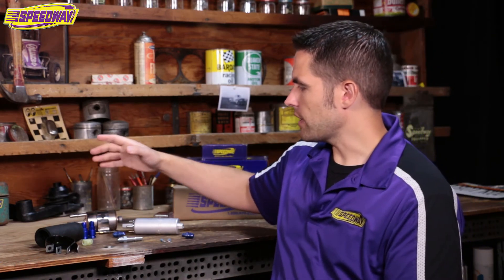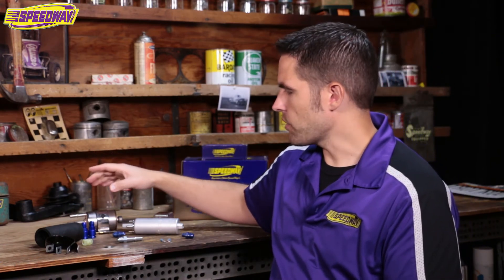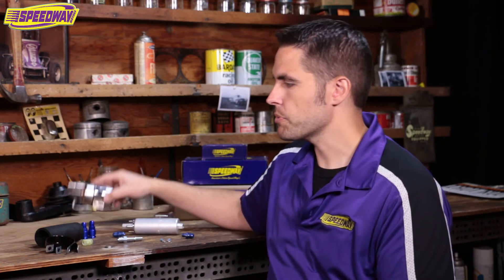Also if you have a truck setup like I do in my swaps, it's already got the fuel regulator on the fuel rail. You can call up and order this from Speedway and just ask to have the fuel regulator removed — that will obviously reduce the price — and you'll get all the other components you need.